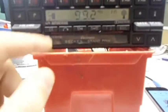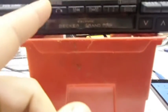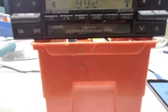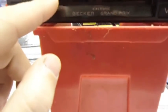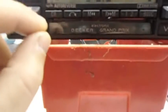These are all switches, so they got two legs. They're all momentary switches, and I believe that they're all grounded. So one leg of the switch has a permanent ground negative, and when you press it, the other leg gets that momentary ground signal, and then the circuitry here interprets that as the different button presses. So what I did was, not on the side of the switch that has the basically constant ground, if you have it hooked up to a battery or your car, the other leg, I scratched the trace on the PCB, so when you press it, the signal no longer goes into the circuitry.